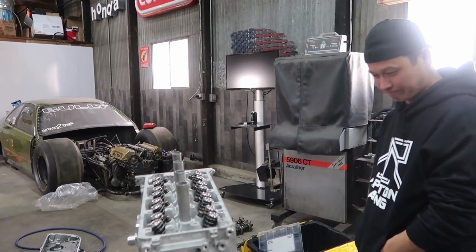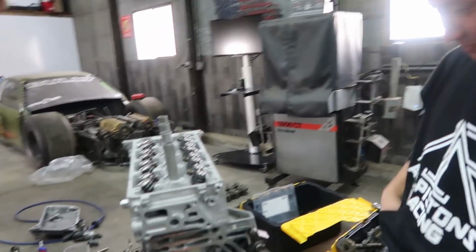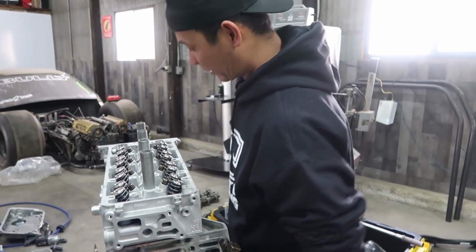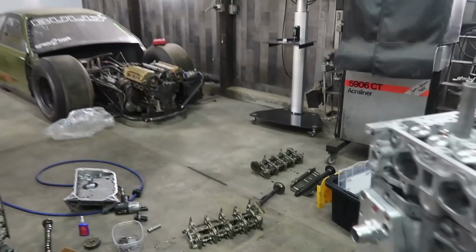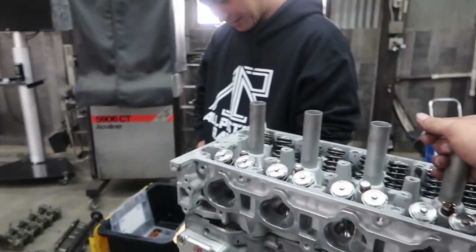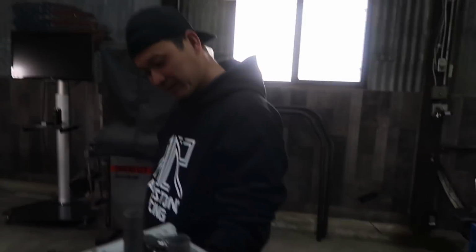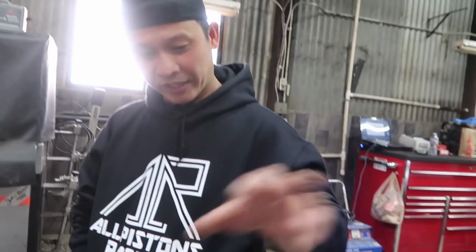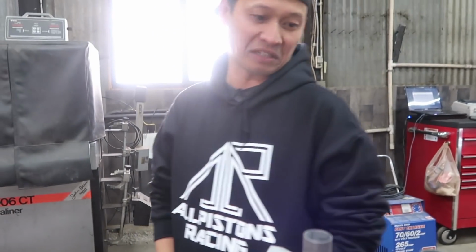Today, huh? Hopefully. Okay. So having an all motor Phong here. Well, I put an all motor together. The head is torqued. So it's a matter of just racking it, putting the cams in, chains, and going. You put the oil pump chain in first. You can get the oil pump chain in first, and then put the cam and the timing chain and everything, flip it upside down and do the bottom, and that's it.